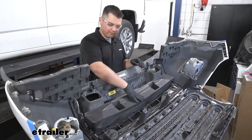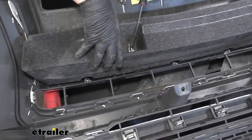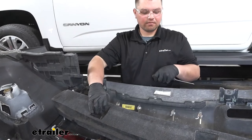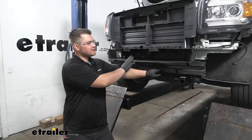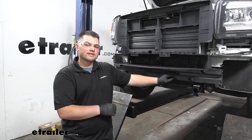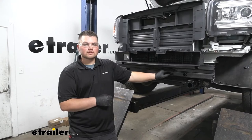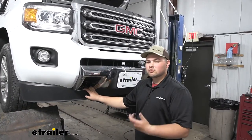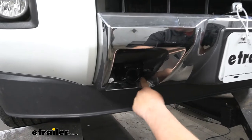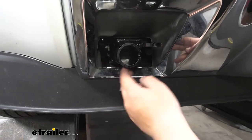Now I need to remove the foam insert in the front of our front fascia — just grab a small flat blade screwdriver and pry out on these tabs. This will not be reinstalled. I went ahead and reinstalled our air dam, and as far as getting our base plate installed we're totally done there. Since our fascia is off, now is a great time to install any other flat towing components. We did actually have to trim a little bit of our front fascia to get our base plate to fit — there's a little housing around where our tow hook was and you just trim around the outside of that. You can follow the lines along the edge and a sharp utility knife will do the trick.